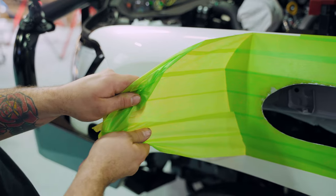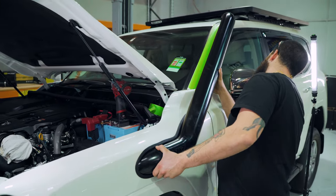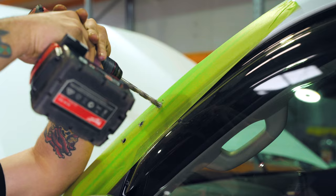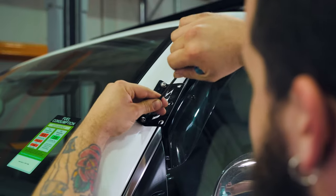Now that we've got our hole cut and painted up, we've got the pinch weld on there to protect the sharp edges from the snorkel. And then we've marked out our holes in the A-pillar for the mounting of the snorkel up there. I'm just putting some nutserts in at the moment to secure it.